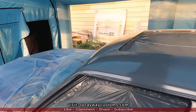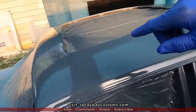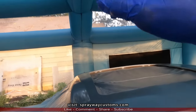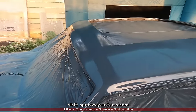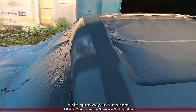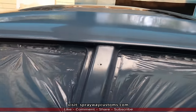Here's the sealer. I was having a reaction right here. I think when the inflatable booth landed on it, it imprinted something right here. The sealer somewhat sealed it up, but hopefully the base sealed it on up. But other than that, everything good.